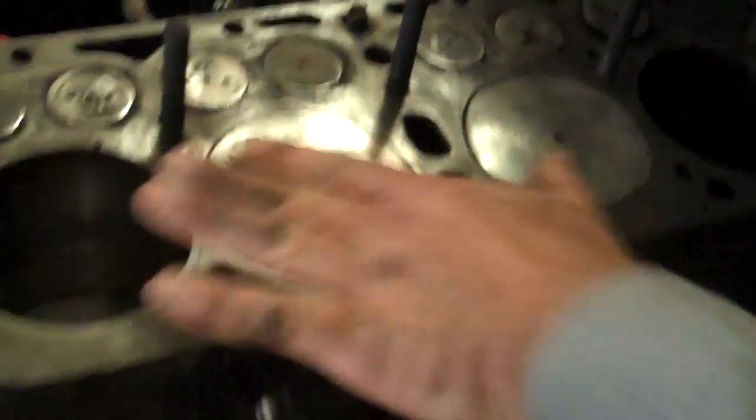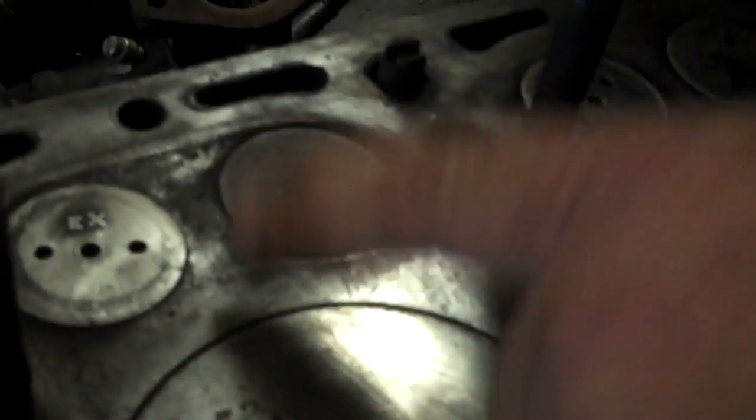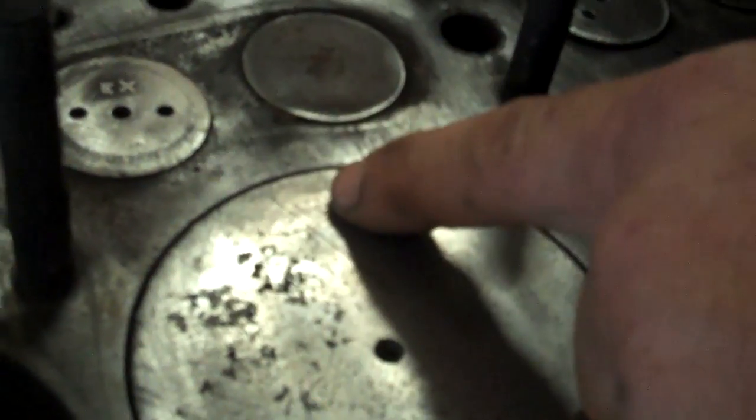I know this was rebuilt, but I don't have enough evidence yet to know why the detonation reoccurred on pistons that have already been replaced and this valve was replaced. I don't know why the detonation is still occurring in this cylinder. It's probably the distributor.